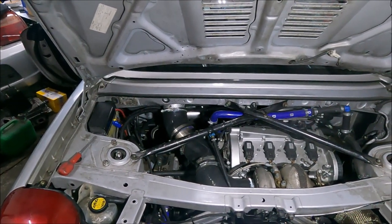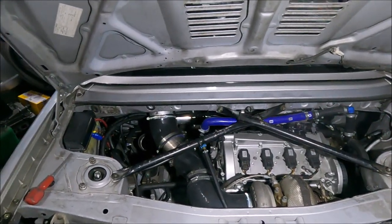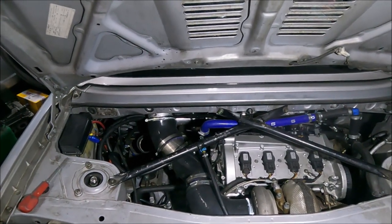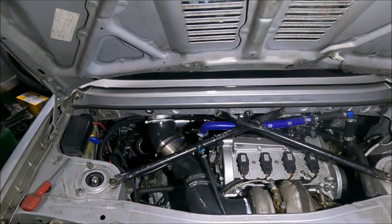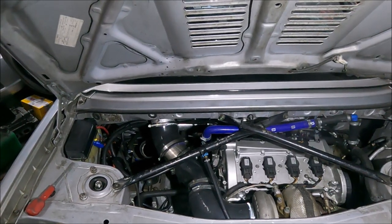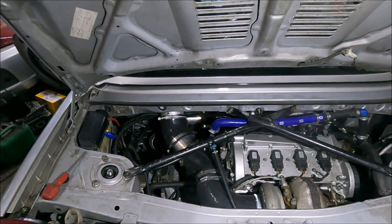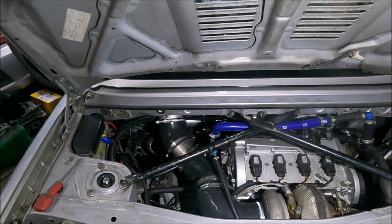The reason is there's no vacuum at partial throttle. The map sensor is reading from the inlet manifold, and at 50% throttle when I'm at say 2 bar at 100% throttle then get off it - if anyone knows how to drive a really fast car, or just on the limit with drifting and that, it's about balance. Suddenly jumping off the throttle is not a good idea if you're right on the limit of traction because things will change rapidly. So I was getting off it more gradually, and in that case a blow-off valve does absolutely nothing.